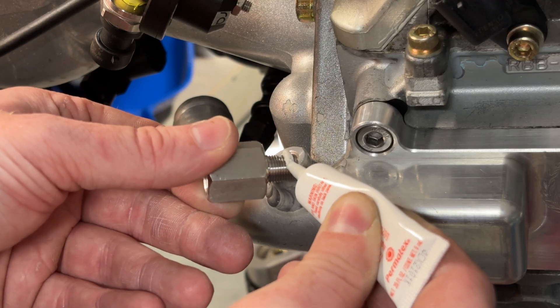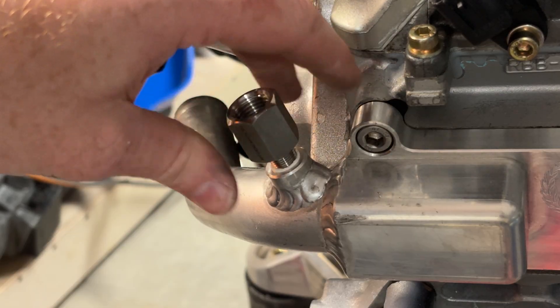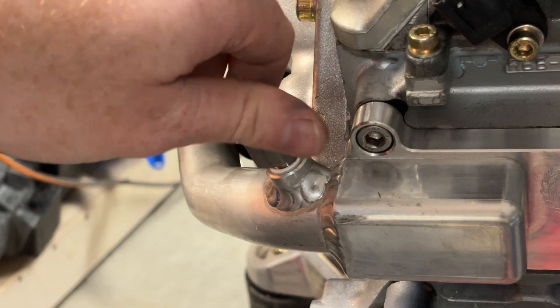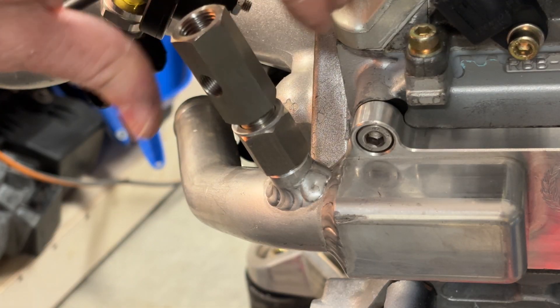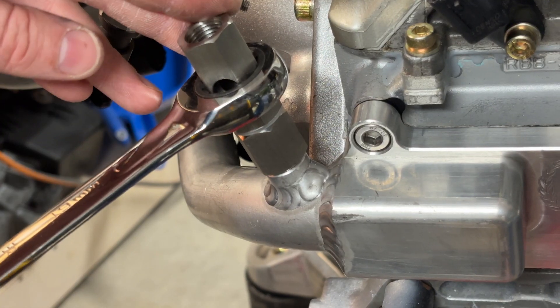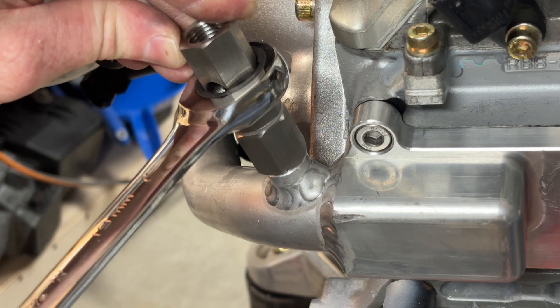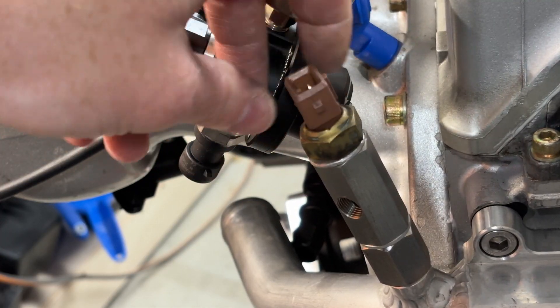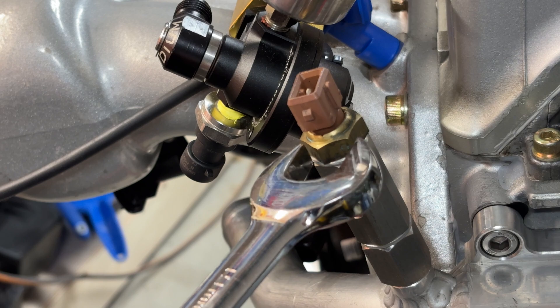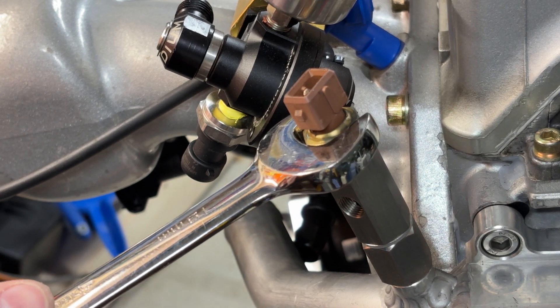This part on the back of the heater neck is meant to be a coolant bleeder location, but I'm trying to retain all the stock gauges, so I'm going to use it to house my BMW coolant sensor. It doesn't fit directly, so I used an adapter and then an oil tap to fit the sensor — hopefully it works.